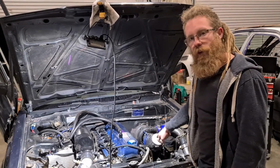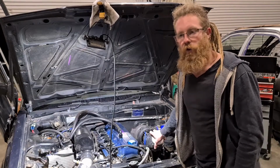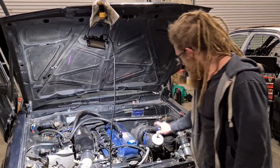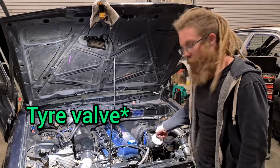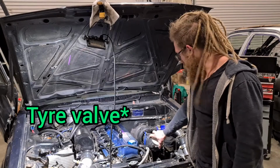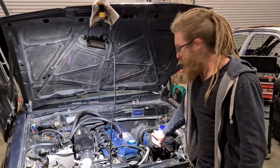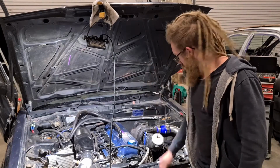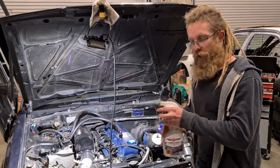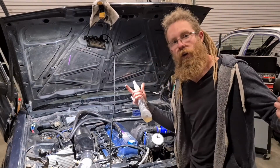which if you guys haven't already, making a boost leak tester for at home is probably one of the best things you can do if you got a turbo car. Basically it's just a PVC pipe cap with a hole drilled in it and a ball valve pulled through it, and some silicone joiners to adapt it to the intake and to hold the cap. So basically all you do, ball valve on a compressor, pressurize the system, have a bottle of soapy water. We'll zoom these in a bit closer and we'll spray around and see if we can find any leaks.